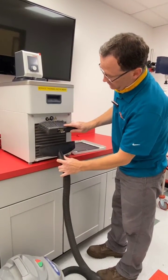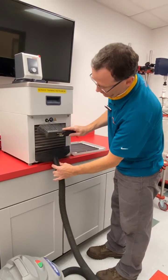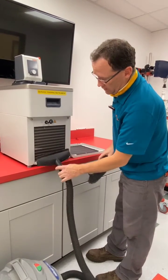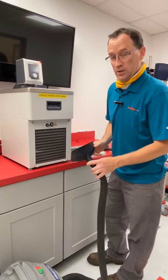All you have to do is take the dust brush and move it parallel over the condenser fins and brush that into the vacuum. That should take care of keeping the condenser clean from especially the hemp dust and so forth.